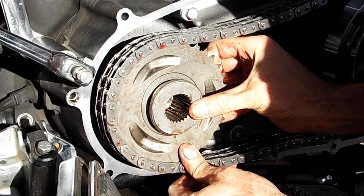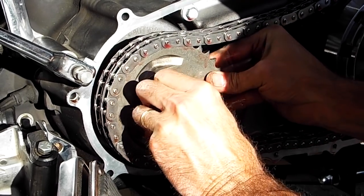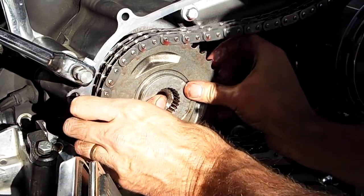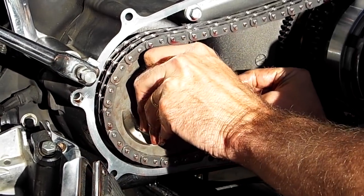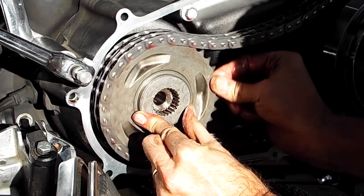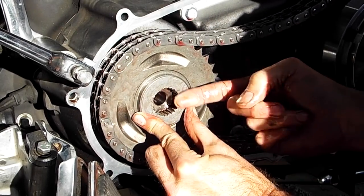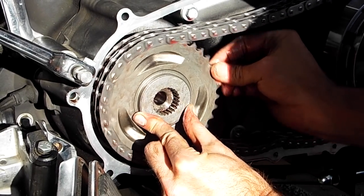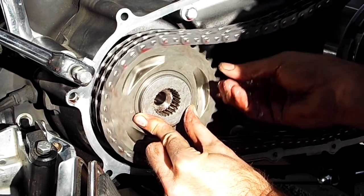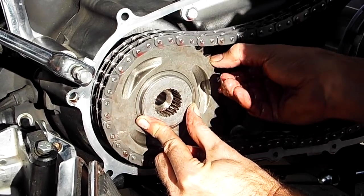You gotta watch the chain down here on the bottom. It fetches up on the inner primary where the bolts go. Okay, we're making progress here. There we go. It's slid back together. And as you can see, here's a demonstration of how it would push against that spring pack instead of being able to slide out like it is now. It would be pushing in on the spring pack with the motor pulses to be a shock absorber for the pistons.